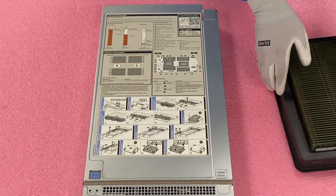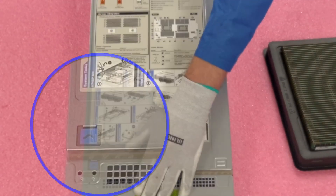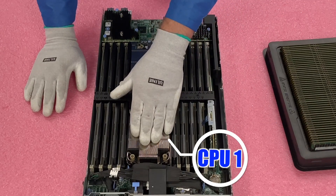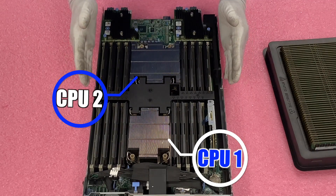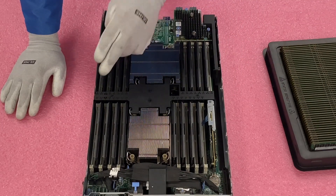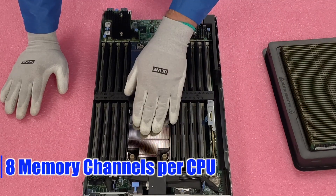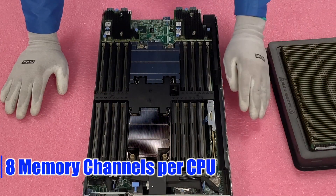We're going to go ahead and take our RAM, put it to the side. We're going to open our latch, just push the blue top. We're going to slide this down pretty much like any chassis you've been in before. So before we hop in, I want to point out a couple of things. This is CPU one, which is going to control the 16 DIMM slots up here. This is CPU two, which is going to control the 16 DIMM slots down here. They are color coded — it goes white, black, white, black. White is the start of the memory channel; black is the second slot in the memory channel, which means there are eight memory channels per CPU and 16 memory channels between the two CPUs for the 32 DIMM slots.